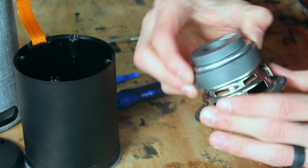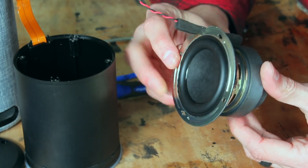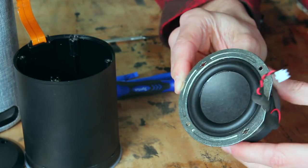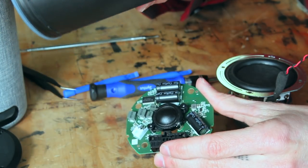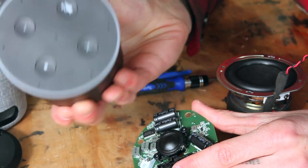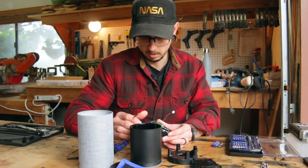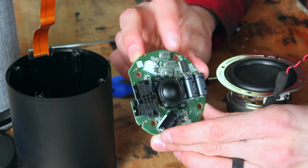All right, so here's the woofer. It actually looks a lot like the woofer used in the version 1 of the Amazon Echo, shielded. So this is a second magnet to shield the first magnet so it doesn't mess with the electronics that are in here. So it looks like this is the only amp so far on the board, because the rest of it, you can see down in here, there's nothing else in here other than the top portion, the Alexa portion of the speaker. So it is a sealed woofer. No porting, no passive radiator. So this TPA chip is the only audio amplifier.